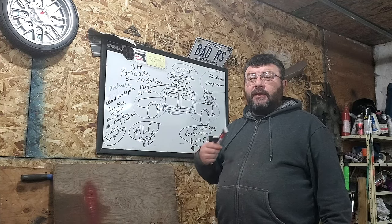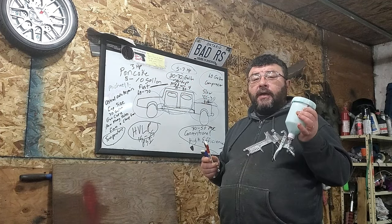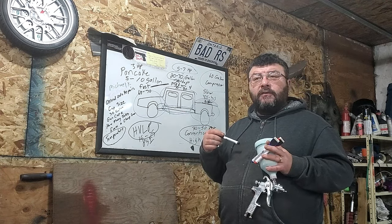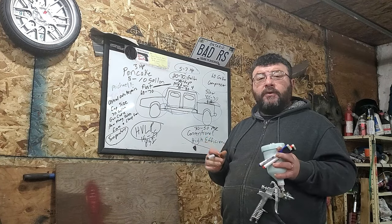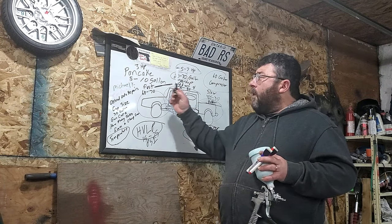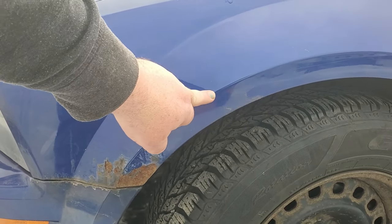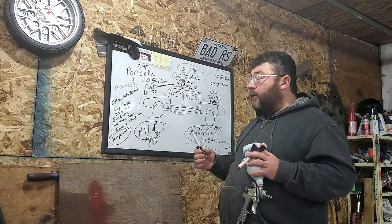I could get into the CFMs but that's not really going to help you. All you need to know is this: all three of these compressors will run your paint gun — it's just for how long. You can do lots of paint work with a three horsepower compressor. I used to do touch-up work and we used smaller paint guns and smaller equipment for small touch-ups — auction work. If you have a three horsepower compressor, it's going to keep you in a small area and you're going to need edge lines to work off of. The paint gun will work, just for a small amount of time, so you have to work in a small area.